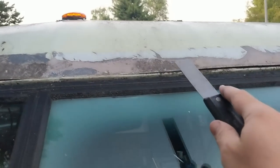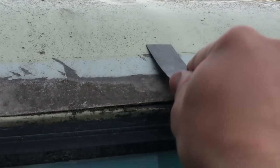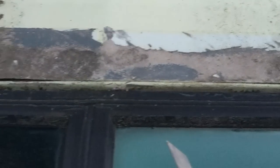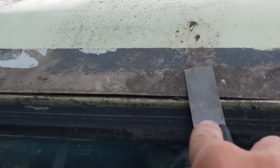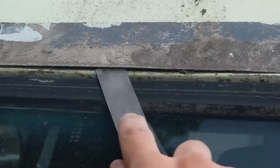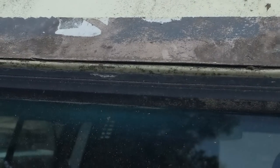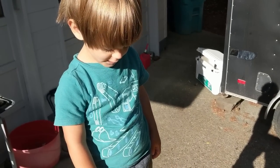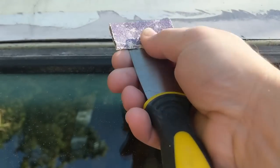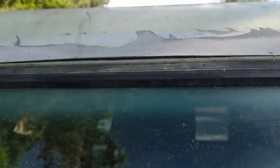There's another problem up here — it's dirty and also delaminating pretty badly between the roof cap and the frame. All of this is sheet-molded compound — two parts joined together. I'm going to sand the top surface and put a thin application of body filler to smooth it out, and then the hard part will be digging out the gap up in here and replacing it with new glue to re-bond that joint. I've got sandpaper wrapped around my putty knife to prepare the joint, and I'm going to fill it with seam sealer.